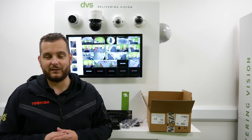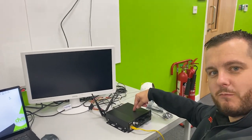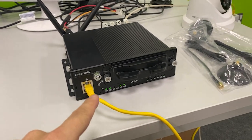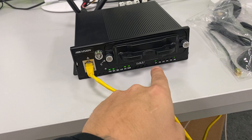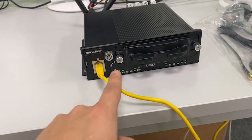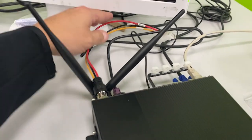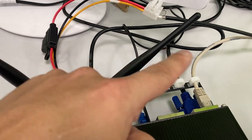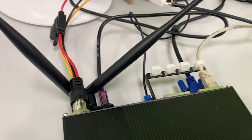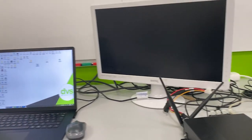There is a little more of an art to installing in a low voltage system like this in a vehicle with the way it's mounted and connected up with the vehicle ignition, making sure it's safe — but it's not massively complicated. So we've got the laptop ready. We've got a screen connected to the back of this mobile NVR. We've got the LAN connection plugged into a TP-Link extender. A camera is plugged directly into POE port one. We're powered up. The two aerials are fitted — the WiFi aerial and auxiliary aerial. We've got a 12 volt power supply with a fuse. We've got the GPS aerial and the antenna aerial connected, as well as the GSM aerial. Just got to fit a mouse into the USB port and we'll transfer over to look at it.